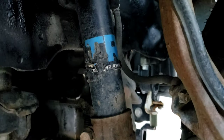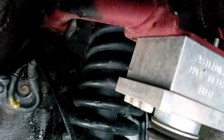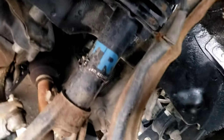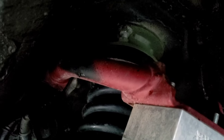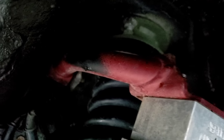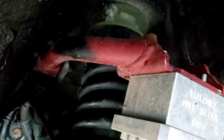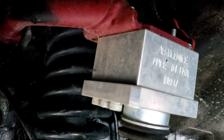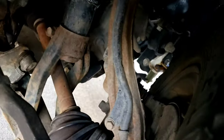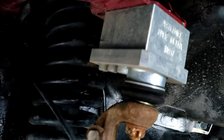Depending on your strut, it's gonna come with 2.5 inch front spacers and 3.5 inch rear. I had to go down to a smaller one because I have the TRQ struts and springs, which are a little bit longer, a little bit stiffer spring. So therefore I had to go down to 1.5 inch. That's custom what I did. Could I fit the 2.5 inch? Yes, but it would have been a little bit of overkill that I wouldn't have really needed at that time, and just put more strain on everything. Now, when I get my extended spindles, yes, I'll probably go up to the 2.5 inch, absolutely.